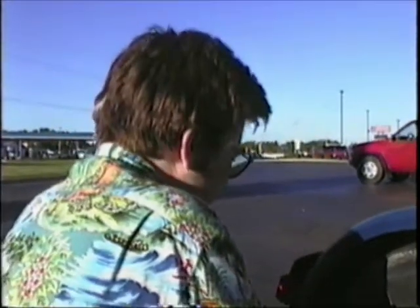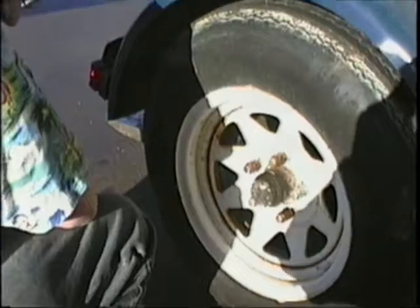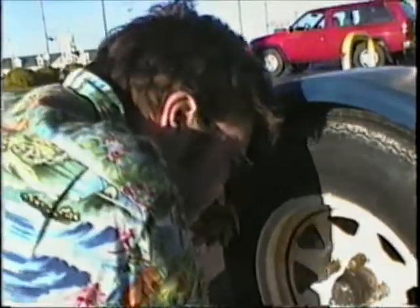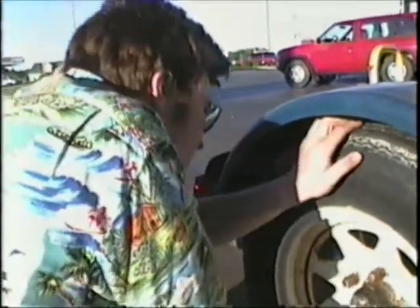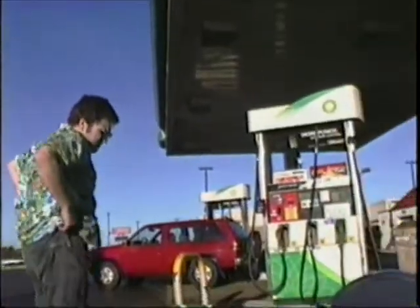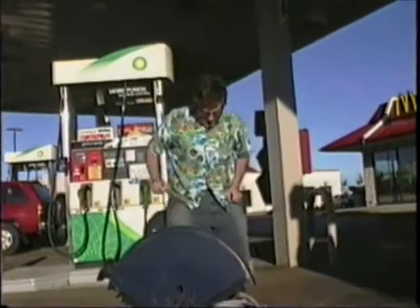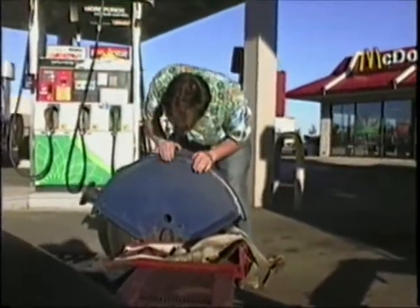After hauling these vans, I would consider replacing the bearing in this if we can find out. This looks like a five lug Chevy, so hopefully that'll be our bearing. Is there any kind of manufacturer tag or anything on this, so you can find a make and model of this tow dolly? I have not seen anything on here indicating manufacturer. Look towards the hitch.